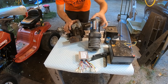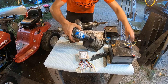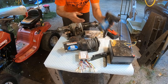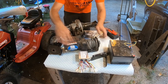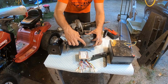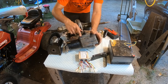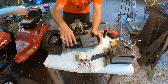That's where this Super Winch comes in. These LT2000 Super Winches you can pick up on sale on a regular basis, and I have blown out two or three of these over the years. If you break them down, you can break it down to this point without too much of an issue. This metal piece on the bottom comes off and we should be able to use these two screw holes as a mounting point somewhere on this transmission — a regular 10mm bolt bolts right in. So there's no reason we shouldn't be able to slice this off and either rotate it or put it in place in order to make a mount.